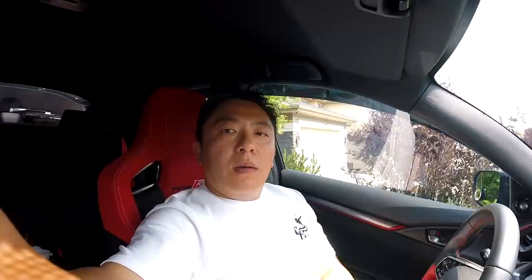And that's all there is to it. As you can see, swapping out the stock subwoofer in your 2016 or newer Honda Civic is neither difficult nor time consuming. For the $105 US dollar cost to buy the Rockford dual voice coil sub, it is well worth the money. Using the stock head unit, the sub is definitely deeper and definitely more powerful, but I'm not going to say it's earth shattering. You really need to add an aftermarket power amplifier as well as a line-out bass correction unit such as an AudioControl LC2i to really get the performance out of the Rockford sub.